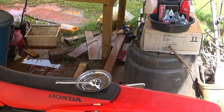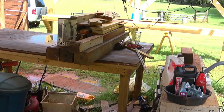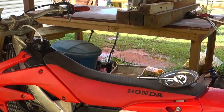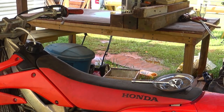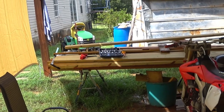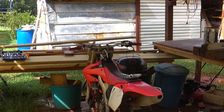I don't know if the Jeep is 100% fixed — I've got to show y'all some stuff on that later, pretty crazy — but she seems to not be leaking. She's overheating but I don't seem to be... I've got to change the oil and see if there's milky stuff in it. After I run it a little bit more, I'll change it and double check. For the meantime we're going to go ahead and do this.